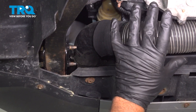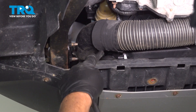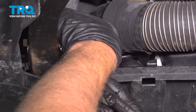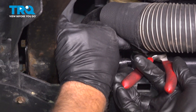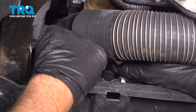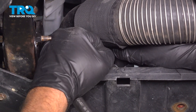Underneath the vehicle, you may have a panel that you need to remove. On the driver's side near the radiator, you can see where there's a drain. You can use a hose, just get over the side where the drain is. You want to have a drain bucket underneath, and you can see where there is a wing nut right here. Use some pliers just to get it to crack free, then grab it with your hand and just loosen it up. As you twist that, coolant's going to come out the hose, and you want to drain it into the bucket.